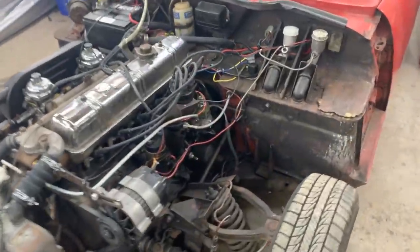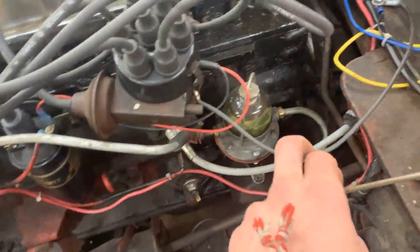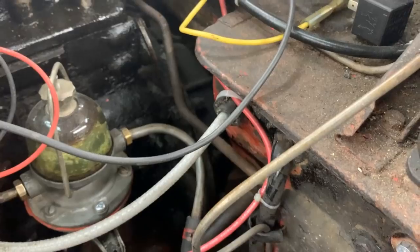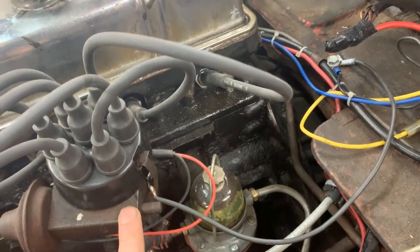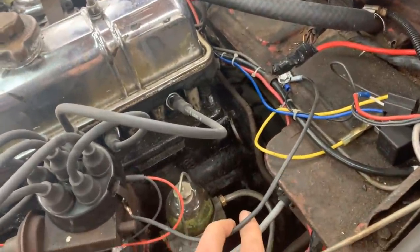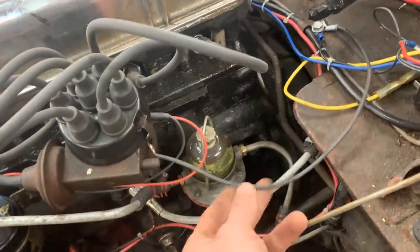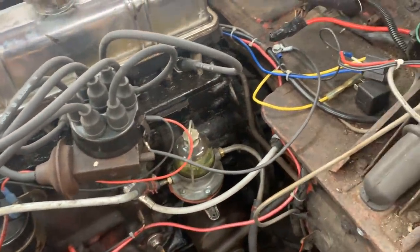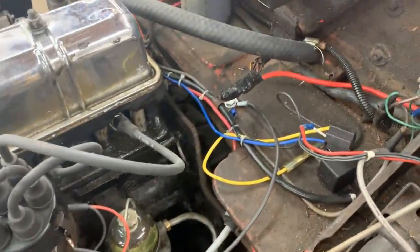I was just looking at the wiring again and I really don't understand what's going on. There's a ground run directly to the distributor. I don't see a ground strap to the engine anywhere - and if there's no ground strap to the engine and you run this ground to the distributor, all of a sudden even the alternator is charging through this cable as the negative of the alternator. If there's no ground strap, this can overheat - that's really dangerous.